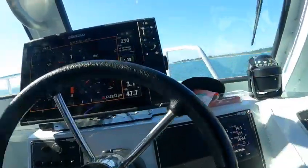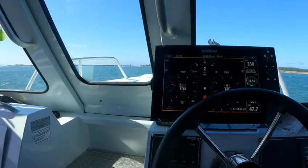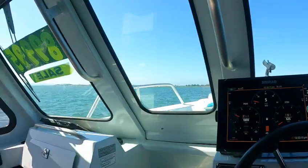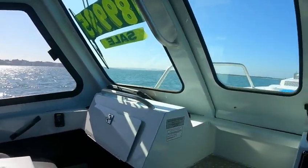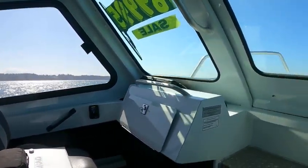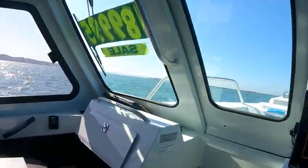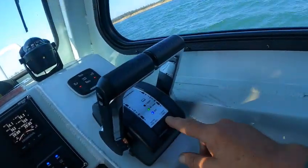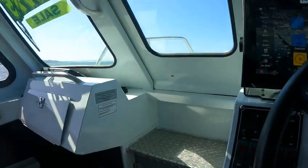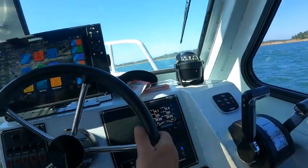It just takes time for it to read back and forth. But the heater went into default again — there's something funny going on. These don't work, then all of a sudden this works, and then the heater quits. It says flame out. The only way to fix that is to shut everything off and then restart it. So I'm going to let this cool down and try this one more time. I can hit this and now I've got all my gauges — everything works up here. But that heater quits, and that could be a voltage drop through that house battery that's doing this. It just seems funny that this doesn't work and then it stays on.